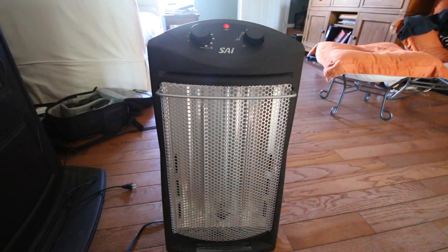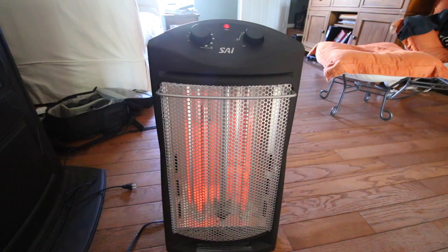It's either a sheet of mica or mica bonded to some sort of substrate like metal. The thing with mica is it is a crystalline structure, so if you put voltage across a crystal it's going to do two things: it's going to heat and it's going to vibrate. That's why the old quartz heaters would vibrate and make all that noise when you first turned them on, and then once they heated up they became more quiet. My quartz heater that I compared this to doesn't smell at all.